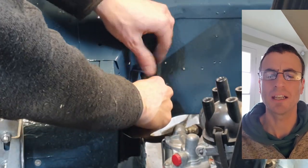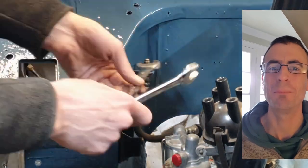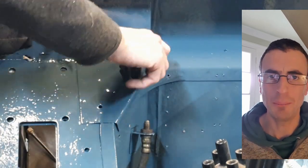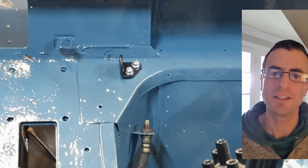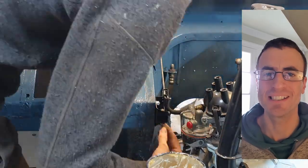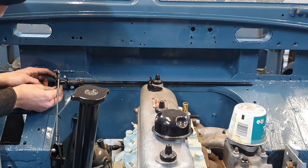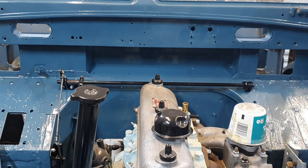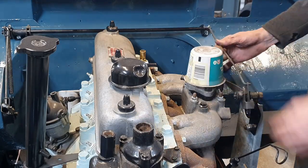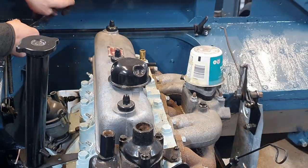I've got the little clutch hose attached to its mounting bracket, and then on go the throttle linkage mounts. It's a very convoluted throttle attachment — it goes along a shaft, up a push rod, across another shaft, down another push rod to a bell crank, and then through another push rod to the carburettor. They definitely should have used a cable, but it's actually quite nice. It leaves a very linear, sensitive pedal feel, and with all the springs in it keeps a slack-free accelerator pedal.